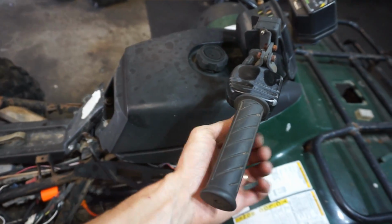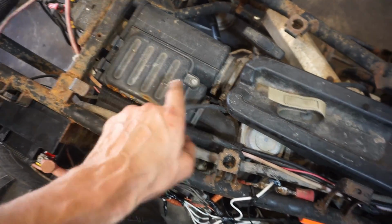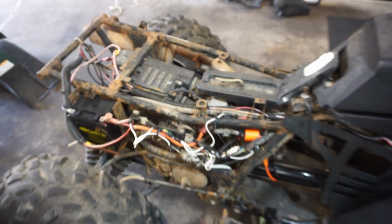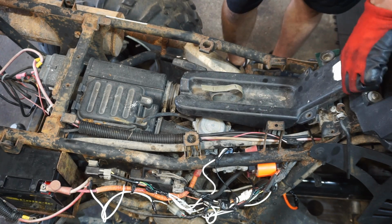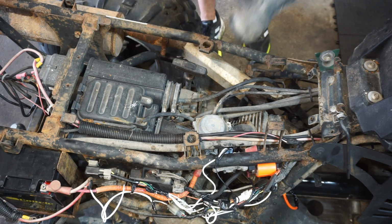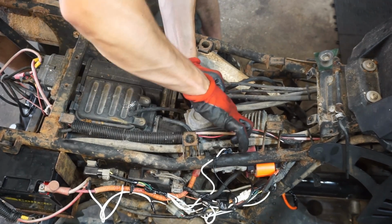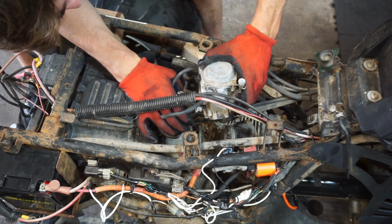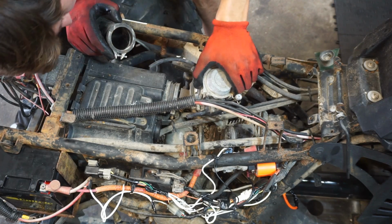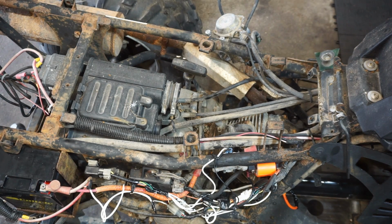Right now everything's locked up on it. See, the cable's just loose, so we're going to take the filter off, get the air filter off. There's probably a nest in there, and then we'll see what that carburetor looks like, and then we'll attempt to start this thing. Lots of nuts coming out of there. Well, at least nothing was in the carb. That's good.